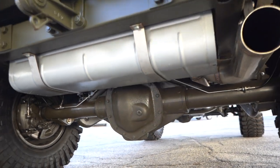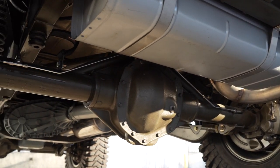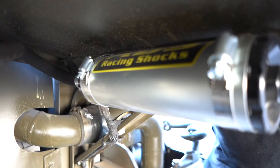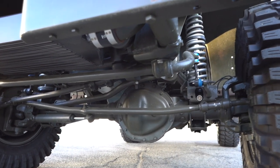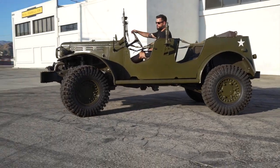It was leaf-sprung in the rear but we didn't want a leaf spring rear — we're not carrying or towing, just carrying some people. We did a triangulated four-link underneath the rear, which is more off-road style, and used ADS shocks all the way around to give it a nice ride. It still has about 10 inches of travel all the way around, which is fairly decent for what he's going to do.